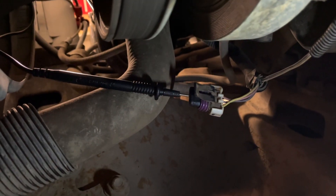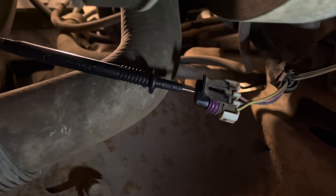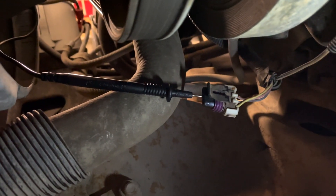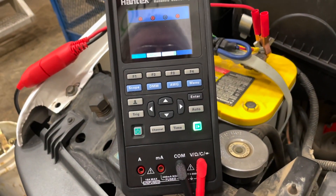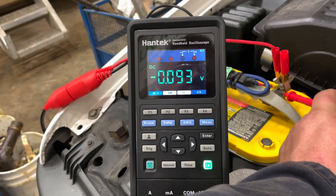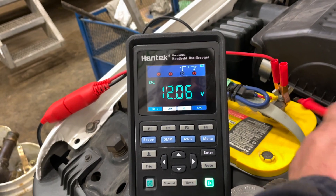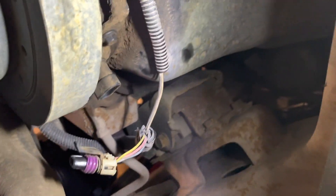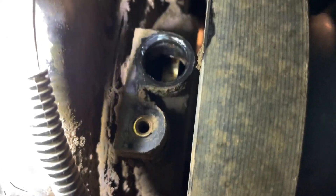Now I'm going to verify with my multimeter. I have the pin out into the ground — the black wire. I'm going to take the other lead and connect it to the positive wire. If I read 12 volts, that double-verifies that the ground is good. You can then go back underneath, do the opposite: pink wire to one terminal, hook up to the battery ground, and you should see 12 volts as well.